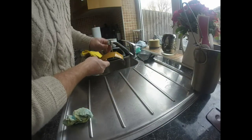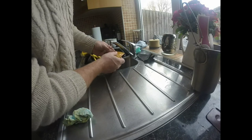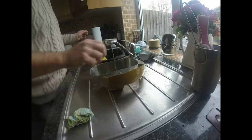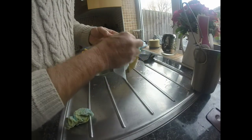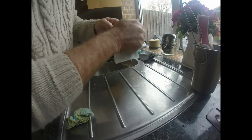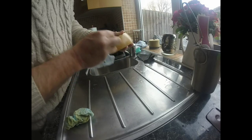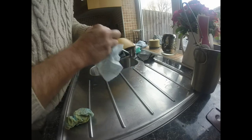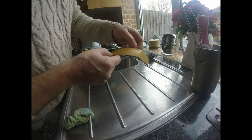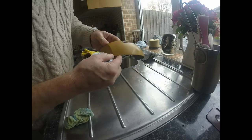That's it, it's now done. Just clean that off - really smooth. You can see obviously when it's wet it's got a lovely gloss to it. I'll dry that off. You can see nice and smooth, all the lines filled. I'm not worrying about these edges because this is where the ears go on, so I need to rough that up for some glue before I weld it from the inside. There you go - nice and smooth, no lines, no bumps. Ready for paint.